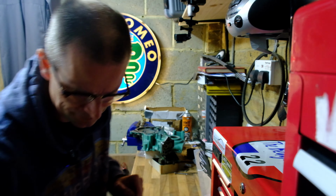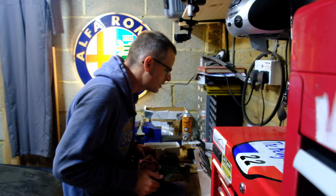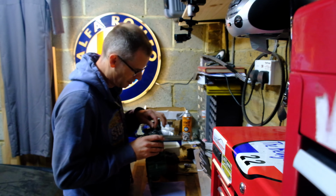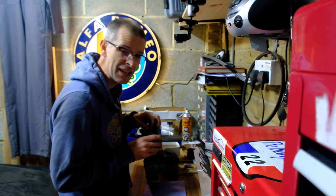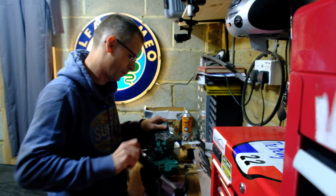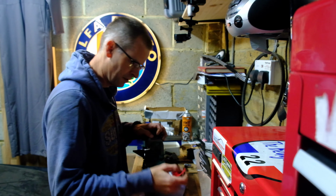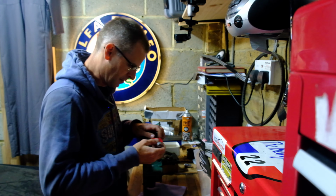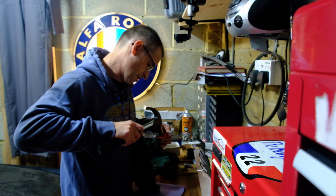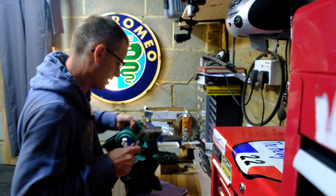Cold coffee time. Now, the next step is install the two roll pins, making sure they do not protrude above the surface. If they do protrude above the surface, I've now got an issue, because they ain't coming out again. Shocking, just a bit of plastic in between, that'll do. There's always something you can improvise with. It's meant to be flush, and I think it kind of is.